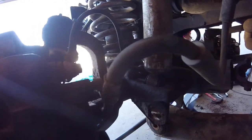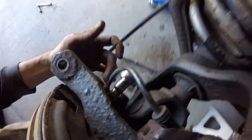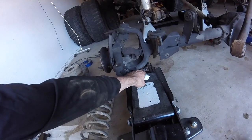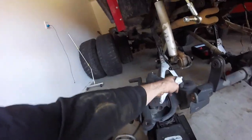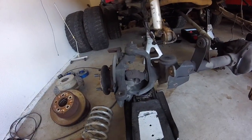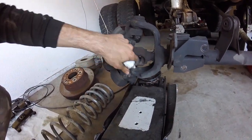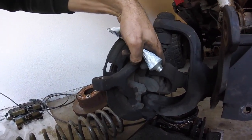When removing the ABS there are two brackets — one on each side — that are 10mm. There are also two more brackets held in by one bolt on top of the steering knuckle, which we're removing anyway, and then one more 8mm bolt right where the sensor is. I found it easiest to mount the axle on the jack, position it for the spring perch to line up, and then start jacking it in place. Note: Rubicon 44s don't come with ABS, so if you want it you'd need to change the knuckle to have the drill hole for the sensor and press a tone ring on the axle.